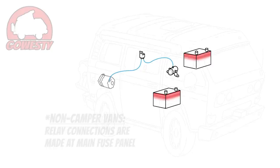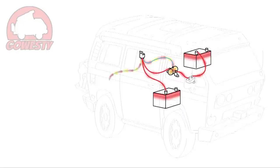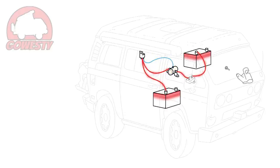The main battery connects to one side of the isolator through a pin at the stock relay, while the auxiliary battery is connected directly to the opposite side, with a circuit breaker inline for protection. The two batteries are completely separate until the alternator begins charging, signaling the isolator to close and joining the batteries into one charging circuit. When the vehicle turns off, the signal wire no longer joins the two batteries at the isolator, and they become separated from each other.